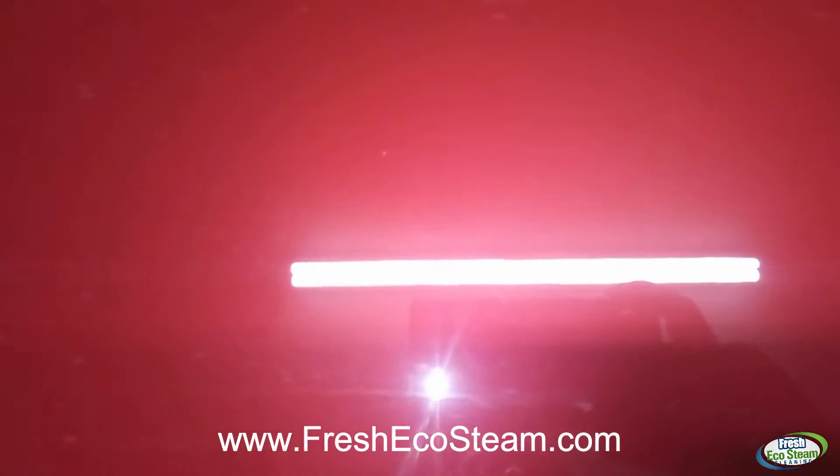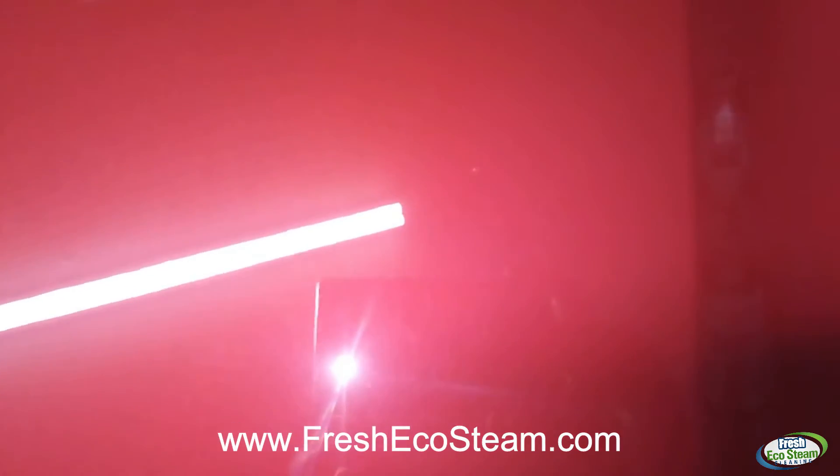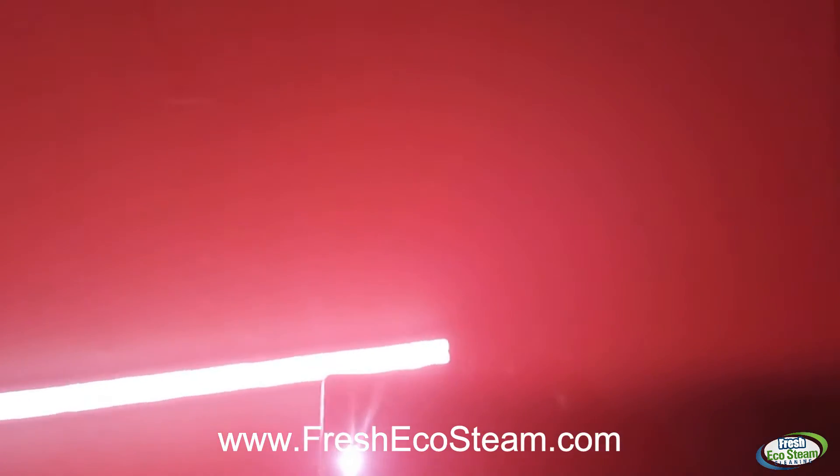Look at the light in the camera — it's looking pretty good. On this side, see how the light is all funky, going all over the place? Then come right here and it's one nice solid reflection. The reason the light is going all over the place is because there are a bunch of micro-scratches in there. As long as I take out this big scratch right here, those micro-scratches will be gone as well. I did one pass and it looks pretty good. The reason I knew it was gonna work is because I did a test spot, and different passes, different compounds, and different pressure all play a big role in how the scratches are removed.